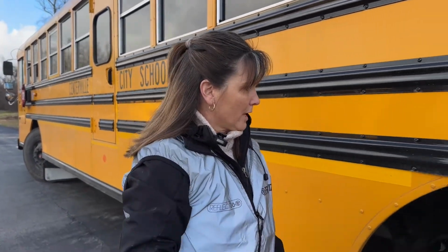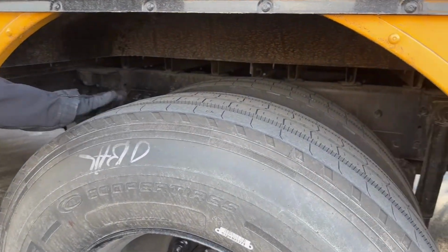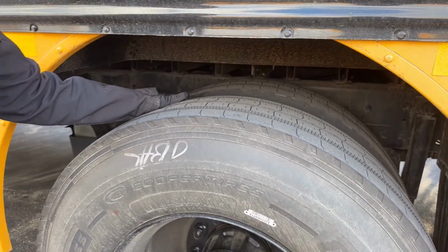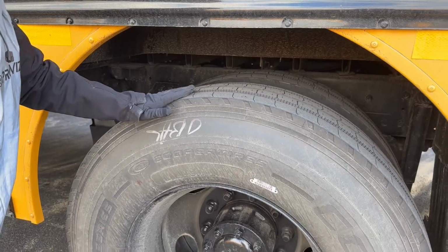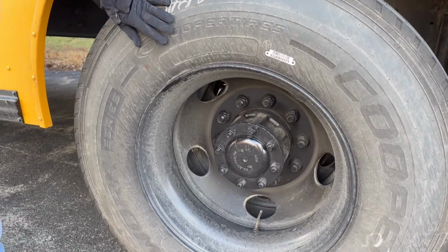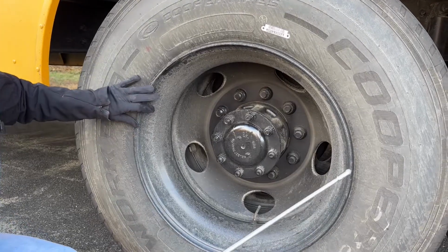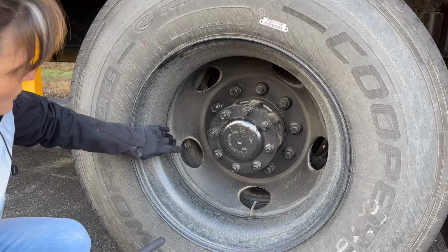We're going to take a look at my buddy wheels, the dualies. They are evenly spaced but have no spacer. The tread depth is 2/32, evenly worn all the way across. The face of the tire, inside and out, have no abrasions, bulges, or cuts. The rim of the tire has no welds other than factory. It's bolted and mounted securely, not cracked or broken, loose or missing.